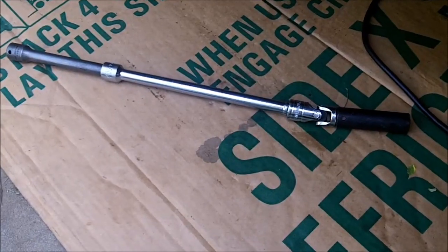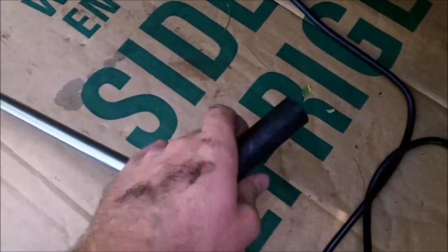Well, here I am under the right side of the car. I got the 3 bolts removed that hold the exhaust onto the manifold. As you can see, they're the kind of bolts with the springs that keep them tensioned. Obviously the nuts are supposed to come off the studs, but mine are seized, so I just removed the studs from the manifold, which I'll deal with later. I just used a long extension with a deep well 15mm.